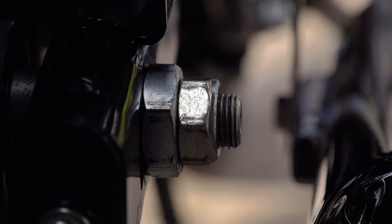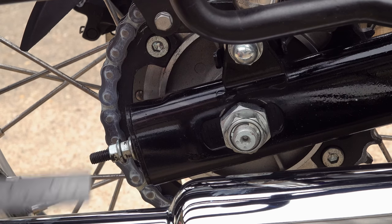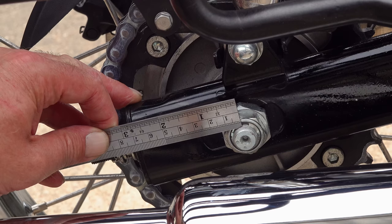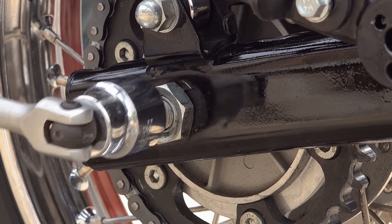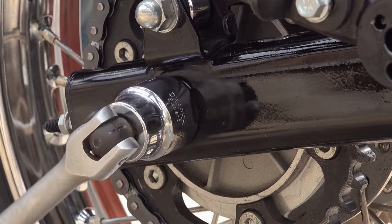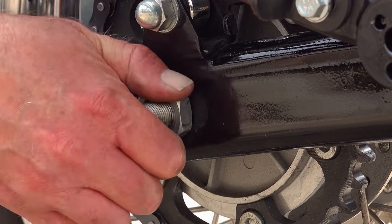It seems rather obvious now, but it wasn't apparent at the time of filming. The assembly is situated way down low on the bike and it's not much over an inch in diameter. I had assumed both bolts fastened onto the same thread, but they don't. The sprocket nut is threaded onto a hollow sleeve that holds the sprocket carrier in place, and then the axle inserts through that sleeve — so both nuts are actually independent of each other. This is to allow for a quick-release wheel system that lets you remove the rear wheel without disturbing the sprocket and chain, which is a fantastic idea — and I never expected to see that on what is really a budget bike like the Royal Enfield Classic 500.